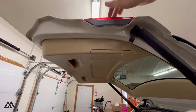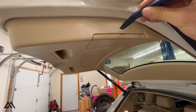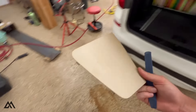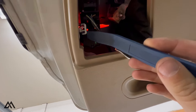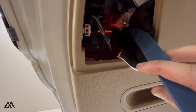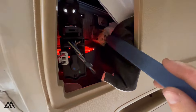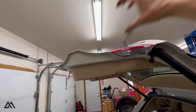This is the tail light we're looking at. It's got a little plastic hatch here — the spot you can put a trim removal tool in and push it in. This little hatch — if you look up here, there's some insulation you just have to push out of the way. Here is the wiring harness going into it; there's another one here. We're going to pull this entire assembly out, which requires removing this nut here that pulls this little retaining clip down. After we remove this nut, this retaining clip will come out, and then this whole assembly will pivot out so we can pull it out.